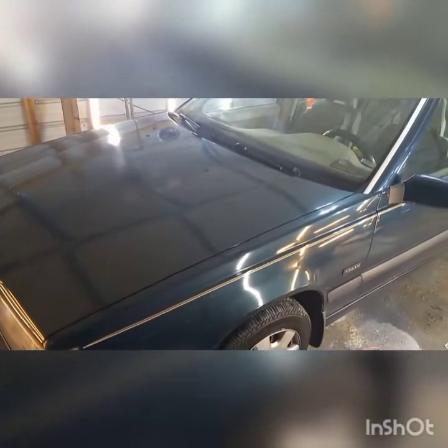Okay, YouTube, we're out here sanding, and I'm using 80 grit on this hood. I'm going to use 80 grit on the top, and probably 80 on the trunk. The reason I'm using 80 is because I want to get these spots all the way down. You see all this stuff right here? All of this has got to come down. This is where I'm trying to get to.